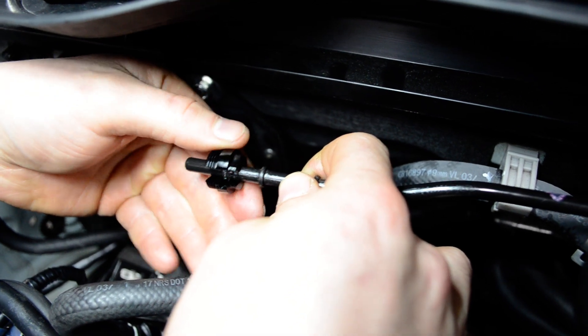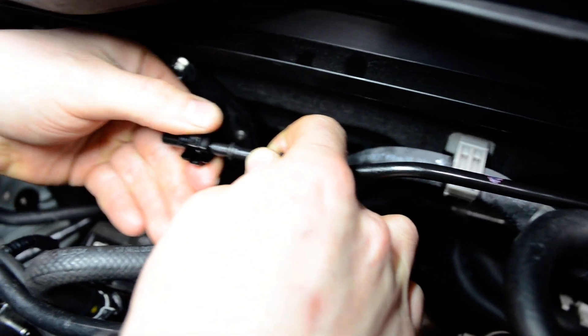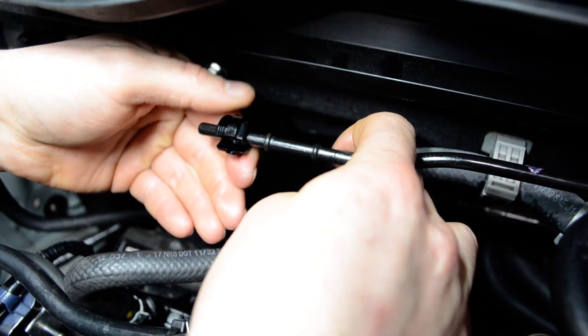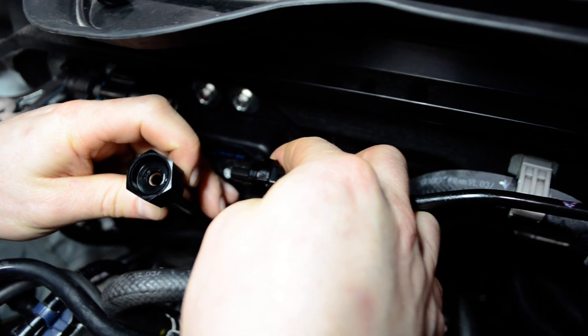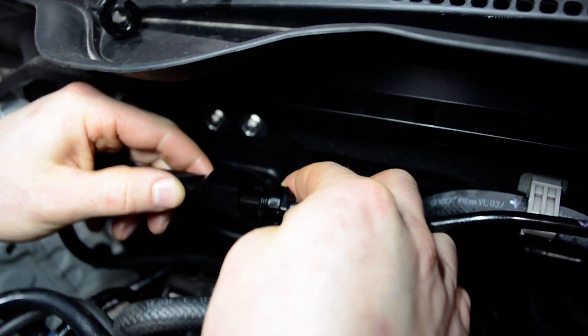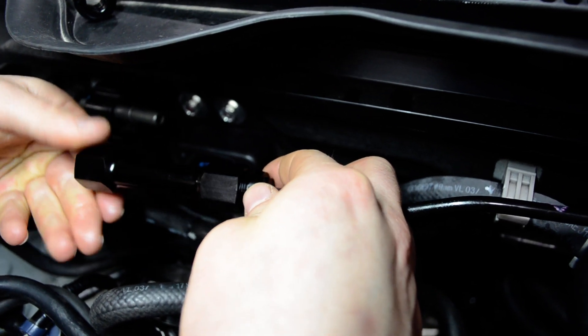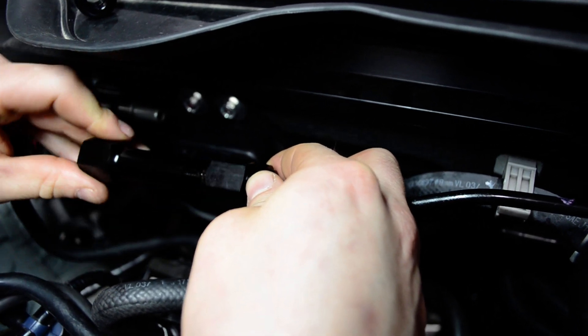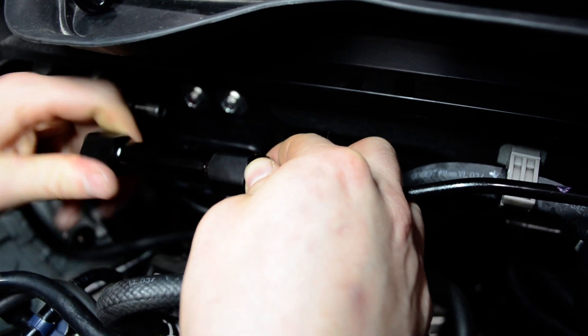Slip it on — it locks this in. It cannot move; it can twist but it cannot move up and down the hard line. These fittings are pre-lubed with grease. You slide it up to meet the threads, apply light pressure, and twist clockwise and it will thread together.